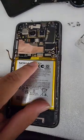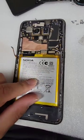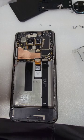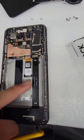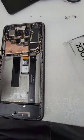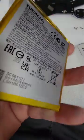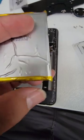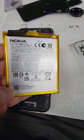This one just comes off like that, then unplug the rest of it. To get to the screen I need to remove the battery because the connector is under the battery. I use 99% alcohol and some pry tools — make sure that you don't damage it, because if you do you'll need to replace it with a new battery.